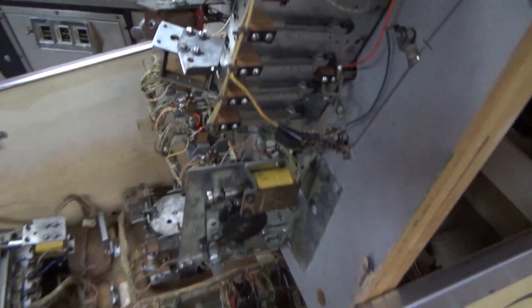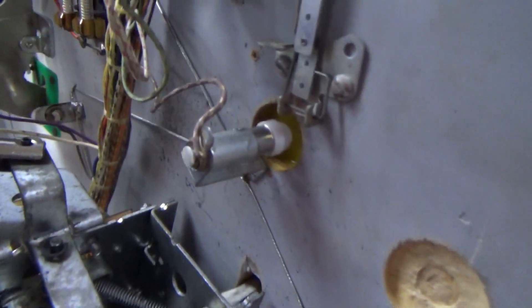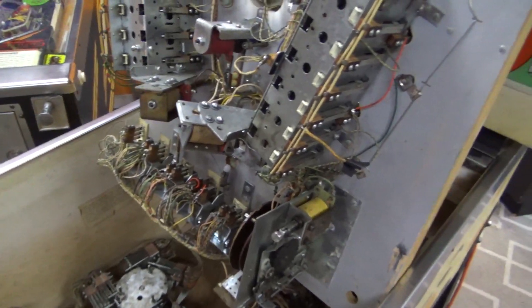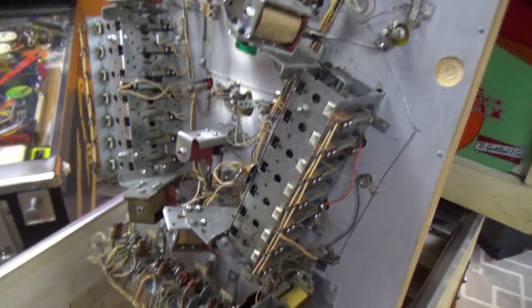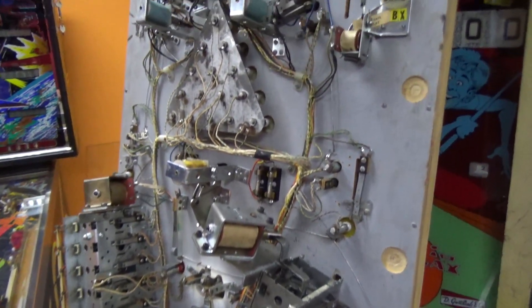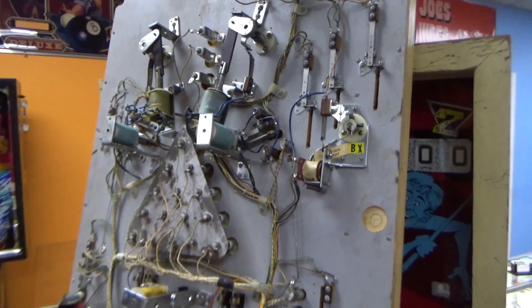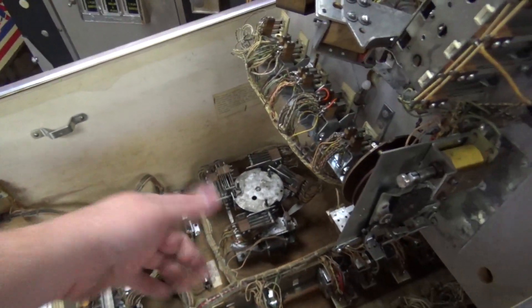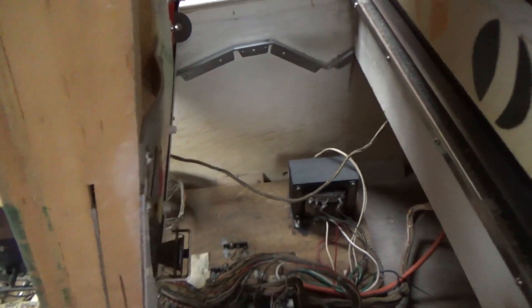Same thing with the LEDs — if you don't like the LEDs, you can take them out and put regular ones in it. If you don't like the regular ones, you can take them out and put LEDs in it. So let's put the playfield down and see what she does in its current condition. I like to open them up before I do that though, just to make sure there isn't a screwdriver laying on the switches that might burn something up when it starts. Everything looks cool.